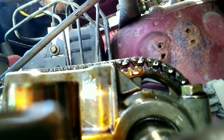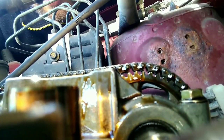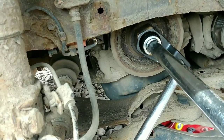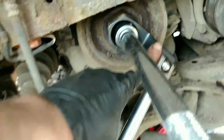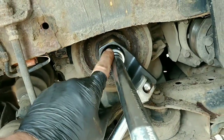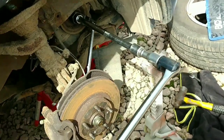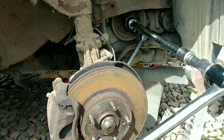I'm thinking the engine was being switched off by the ECU when it realised the cam and crank correlation was so far out - to preserve the engine. That's pretty bad. To undo the bottom crank pulley, it has a 19mm bolt and it's tight. I bought this tool - I had to hammer it in because of the rust. Once hammered in and happy it wasn't going to slip, I put the breaker bar on with an extension going to an axle stand and a big bar. It went with a big crack - definitely a good tool for this job.